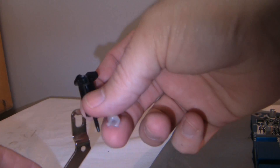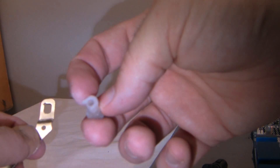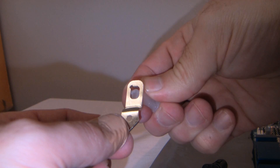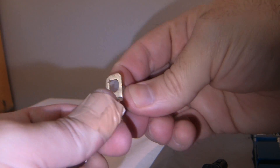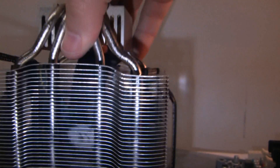I'm going to show you how to put these push pins onto the bracket. I'm using the LGA 775 bracket. There's a little notch at the top left — align those two up, go in at an angle, and push up in there to secure it.